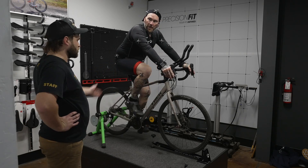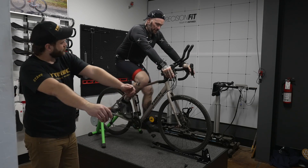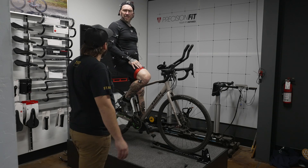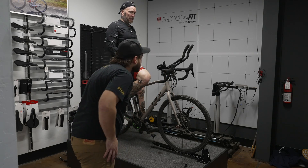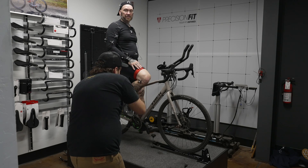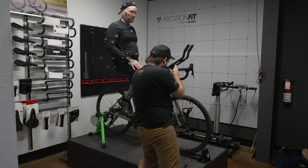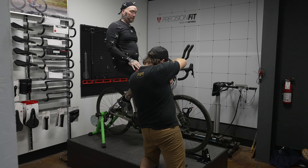First, just want to make sure our base bar is in a good position before we move on to the aero bars. The shoulders are coming a little bit further forward than I would like, so if I can decrease your reach a little bit, I think that'll be better. We'll start at about a half-inch. You have a pretty aggressive reach on this handlebar — that's a stock bar. We can basically shorten up the whole cockpit: a centimeter on here, taking you from a 100 to a 90-millimeter stem.